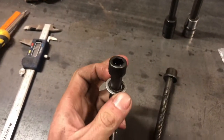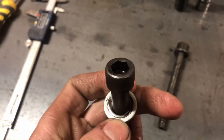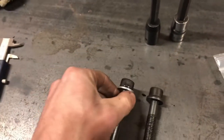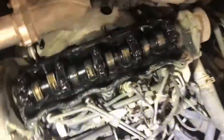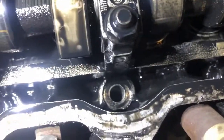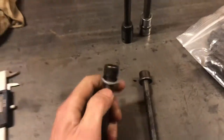You're gonna need 10 of those and then the thickest washers you can get. These are actually fairly thin and you can kind of see the washer bends a little bit — not terrible. But it cannot be any wider than 23mm because it sits down in a recessed hole, so if it gets too big you won't be sitting in the casting. No bigger than 23mm; these are just a hair bigger but they're snug enough to fit in.